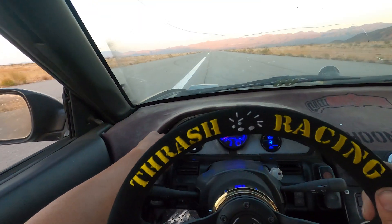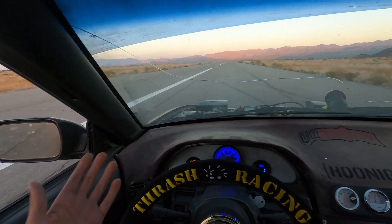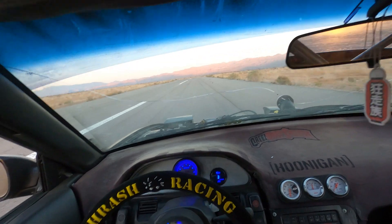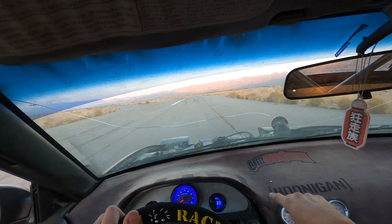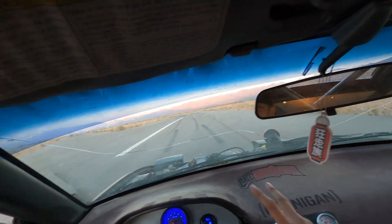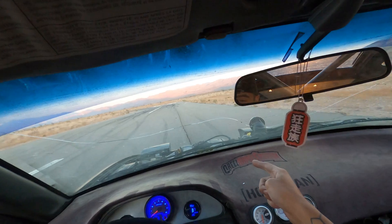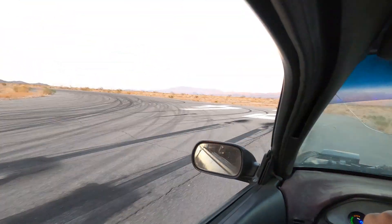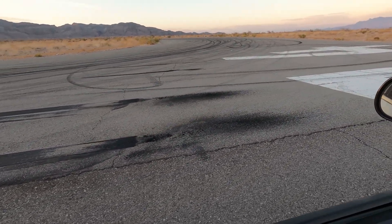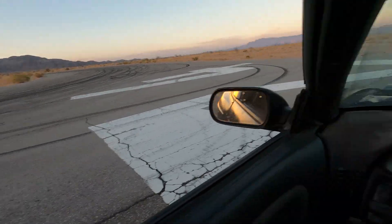Every time I hit 100 on here, which is really hot, it cuts off — which is good because I would keep going and probably roast everything in the car, but it's killing my fun. There's a little bit of leak still. When we bled it we went to 15 PSI, and the cap's good for 20, so we gotta pump it to 20 — we would've seen more of a leak. Look at these tire marks — someone's doing some drag races or something out here.